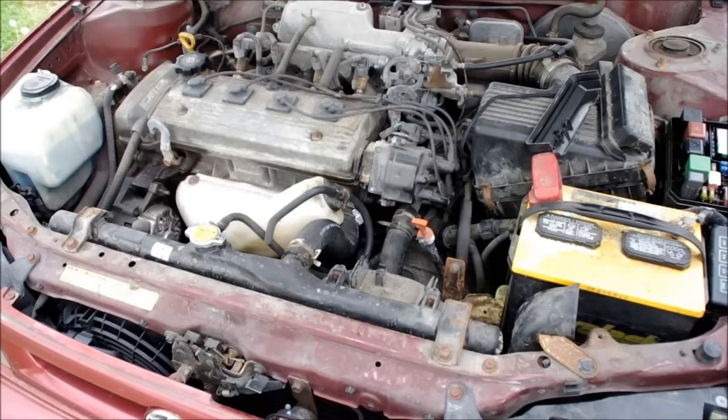I hope this video was helpful to you. In many cars, the cooling fan is driven directly by the engine through a belt, so you may need to check a cooling fan belt if it's not working. However, most cars have an electric cooling fan system like this. And even if you don't have a wiring diagram, just by looking at the relay and finding out if it's normally open or closed, and then finding where the sensor or switch that controls the relay is, you can probably solve the problem. I hope you enjoyed this video and found it helpful. If you have any questions, please feel free to put them in the comments and I'll answer them as soon as I can. Thanks for watching.